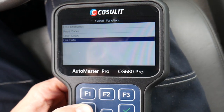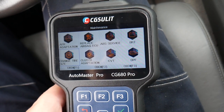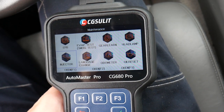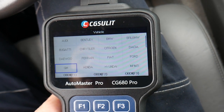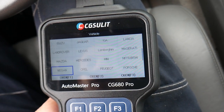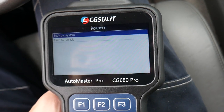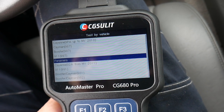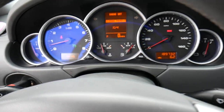Now under maintenance, usually you have functions like battery register, different tire size for winter, and most commonly the oil reset — super convenient. On that Porsche specifically, you cannot do it without a computer; there's no manual combination. You have to use the scanner to reset it. Right here under oil reset, select by vehicle, select Cayenne, choose V8 — code complete. It reset the oil. You can see we no longer have the engine light on — everything is reset.